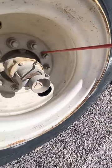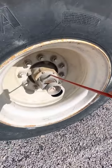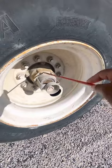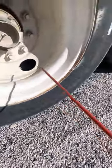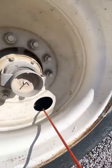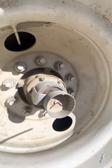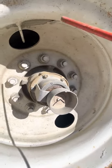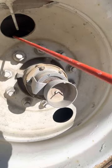There's no signs of metal shavings or rust indicating looseness. My axle seal, properly mounted and secure, not cracked, bent, or broken. All bolts are present and on tight, and it's not leaking. My inner and outer valve stem, they're both properly mounted and secure, not cracked, bent, or broken. The cap is not present on this one, so you will report this on your DVIR.